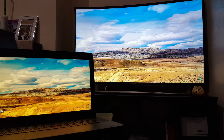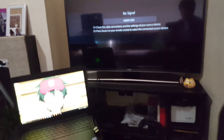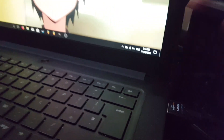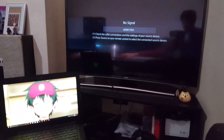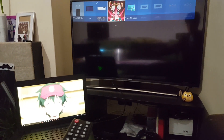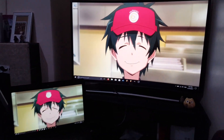Next we're going to use a wired connection via HDMI. All you need is a HDMI cable connected from the back of your TV, with the other end available to plug into the HDMI port of your laptop. Once you've plugged in your HDMI from the back of your TV to your laptop, take your remote. I know that this HDMI is HDMI 2, so go to screen selection options, go to HDMI 2, press OK. And there you go — your laptop screen is now duplicated onto the TV screen.